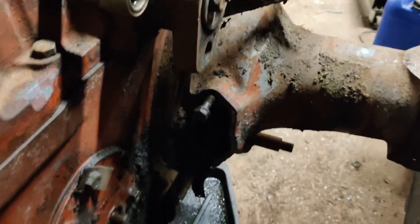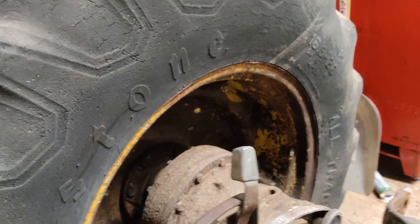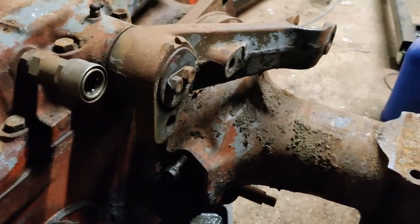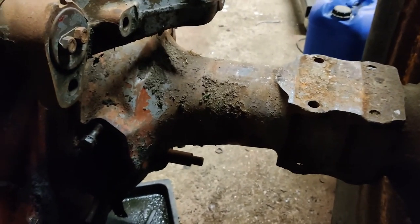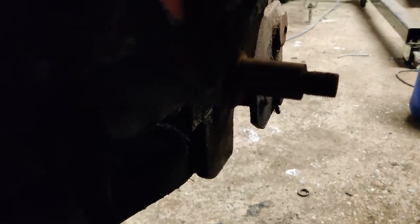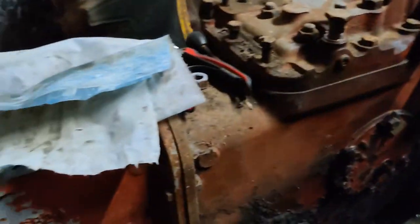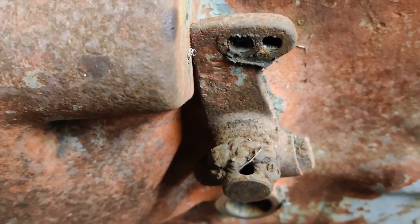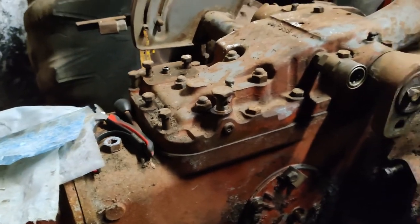As I've got a bit deeper into it down here, I'm just amazed that there's nothing leaking out of the seals on either end of the axle. My only explanation for that is that there's nothing in there. It's leaking oil out of every other seal. There was actually an oil level in both of the brake housings, so it's had no brakes for who knows how long. The drop brackets to relocate the lift arms were missing completely.